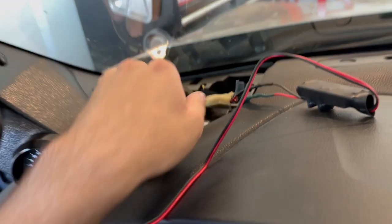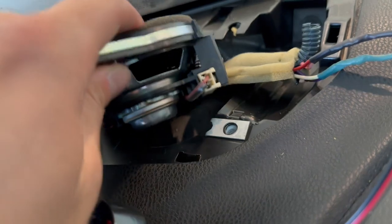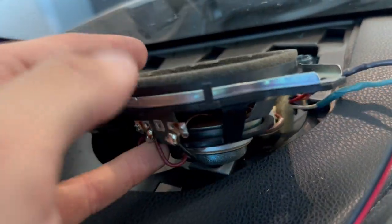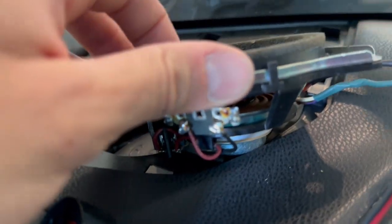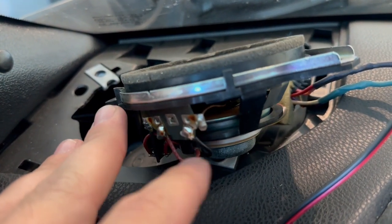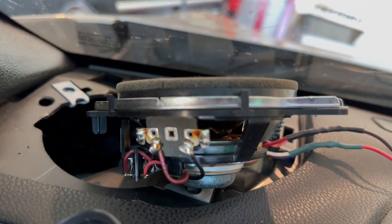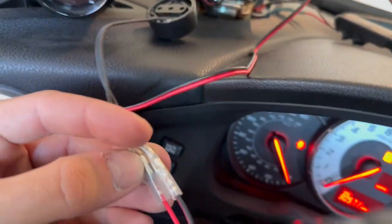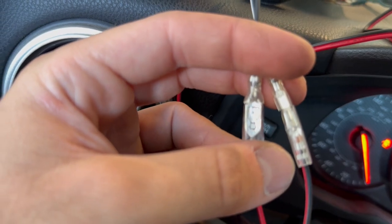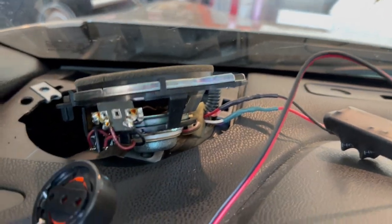Eventually I'll change out these speakers too — those are pretty easy. For the rear speakers, all I did was take off the connector, which has a red and black wire, then solder the red wire to the positive lead on the speaker and the black wire to the other lead. The positive lead on the speaker I'm using is physically bigger and the negative is smaller — same as with these tweeters. Then I just plugged the connector back in and it worked normally.